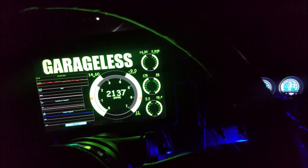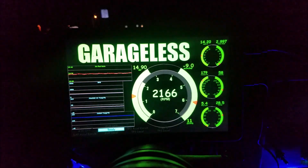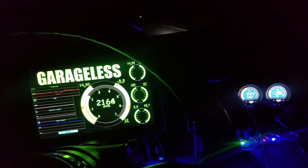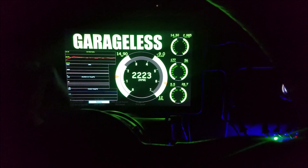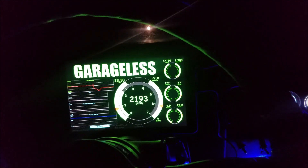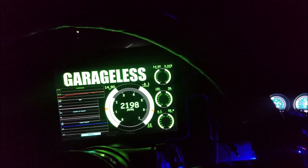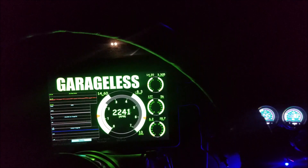So that's a pretty good time — everything's kind of jumbled up and I gotta get back in the habit of recording things. That's my new dash, pretty neat. Had a good time and did a lot of tomfoolery. Guys, if anyone has any suggestions — I may have figured it out before this video drops — but it can't rev past 5k. I've tried a couple different resistors; I'm probably going to try removing the VR1 from the loom and keeping it by itself to see if that makes a difference. Anyway, like, comment, subscribe — see you guys in the next one.